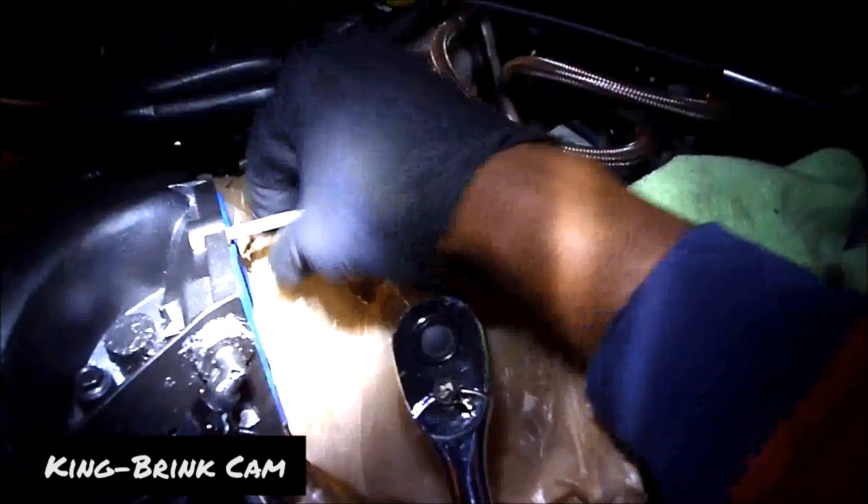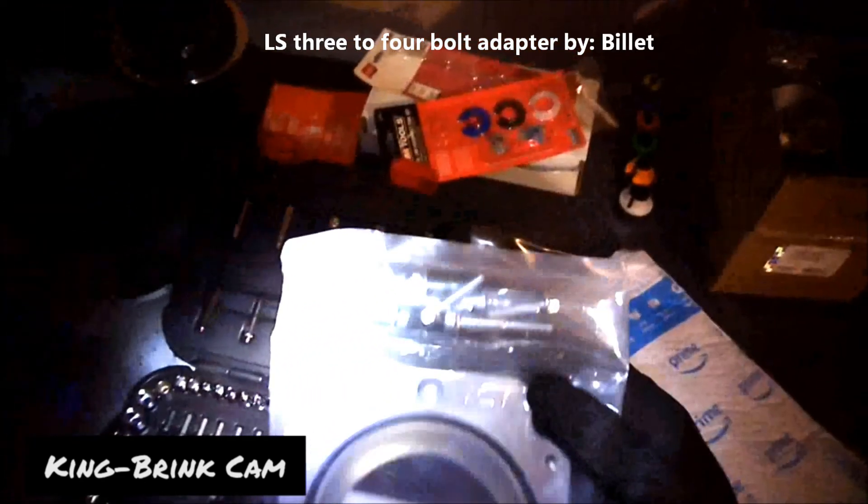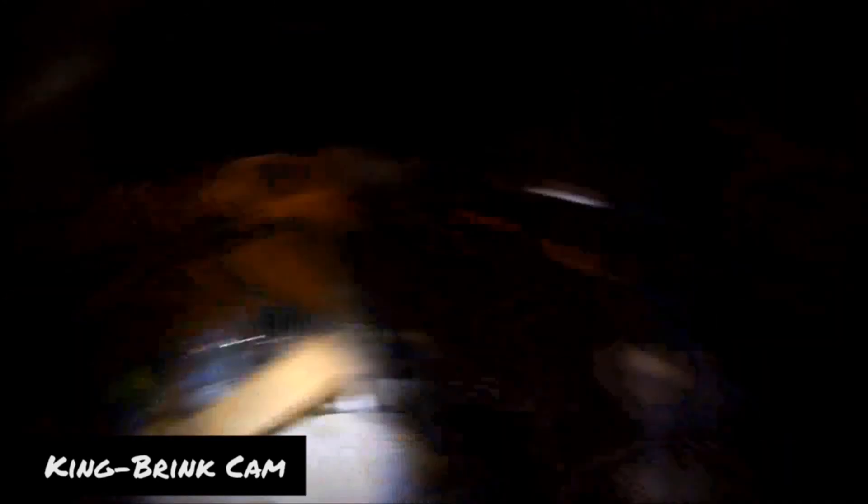Just unscrew it and out it comes. Make sure you wipe up this area inside here and you'll be good. Go ahead and get to work because more likely when you're taking the studs out — you want to put something like this in here: it's an adapter by Billet. It comes with all the necessary screws that'll go into the intake. Usually when you're doing that, you're using an adapter plate for a reason, and this is the reason right here. Now this is AC Delco part number 217-3153 — the LS3 throttle body.